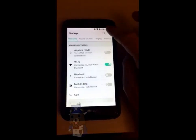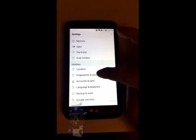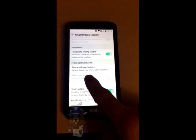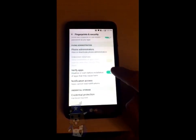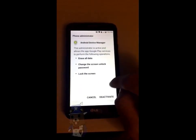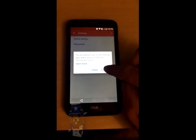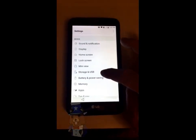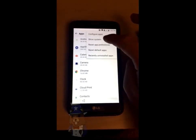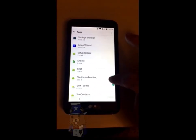Say continue. Scroll all the way down and I'm going to show you that unknown sources is grayed out and disabled. I went ahead and turned off verify apps, and now you want to disable the Android Device Manager under the administrators. Deactivate that and go back to manage accounts. Say yes. Now go to apps, click the menu button, click on show system, and scroll all the way down until you get to the setup wizards — there should be two of them. Tap on the blue one first.